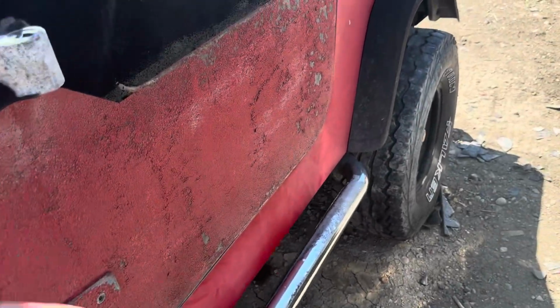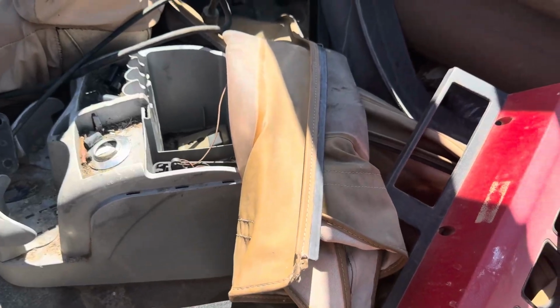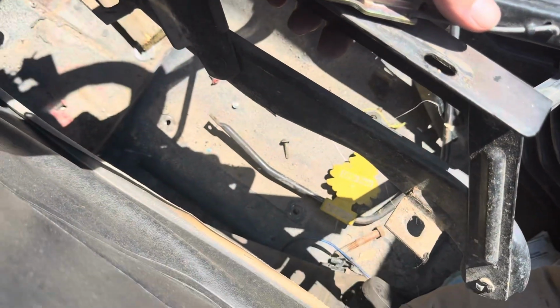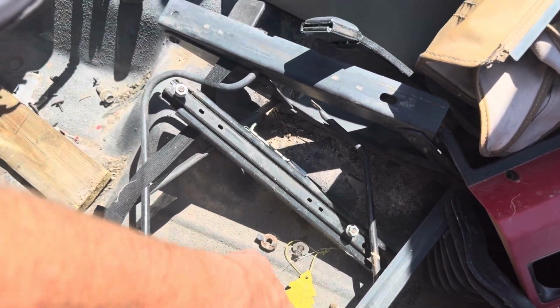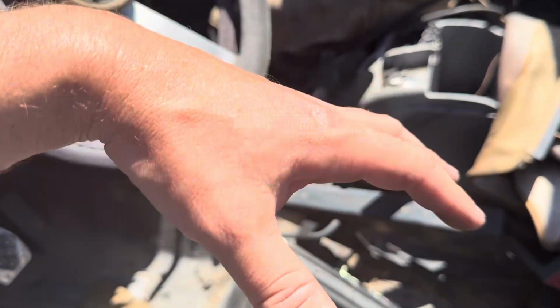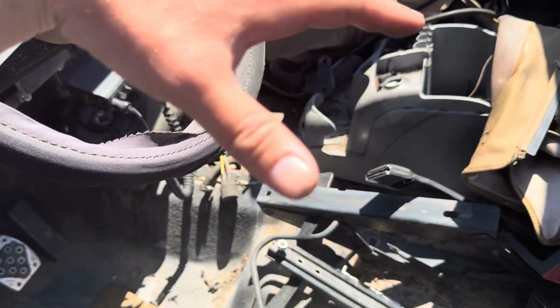So other areas that we'll have to pull that are potentials are the bottom of these seat brackets. This one's actually already pulled, so that one is in good shape. Those don't look cracked. But sometimes when these seat brackets get loose, people don't tighten them. They start lifting as they break and gas, and they eventually start cracking the tub. So again, not a hard fix, but there is a fix there, so we want you to be aware.